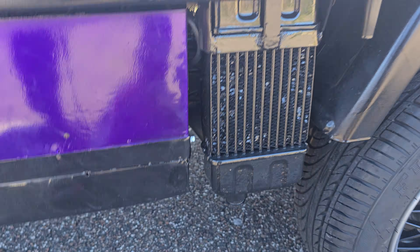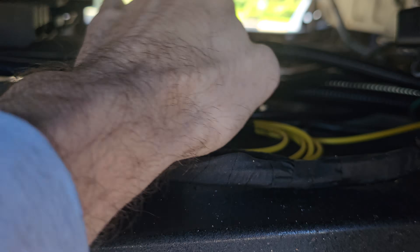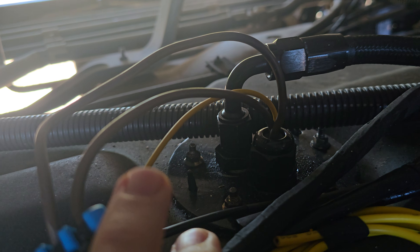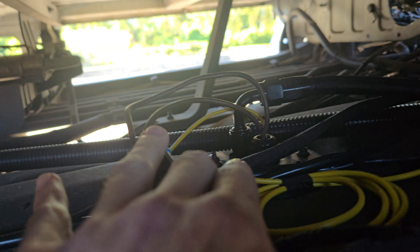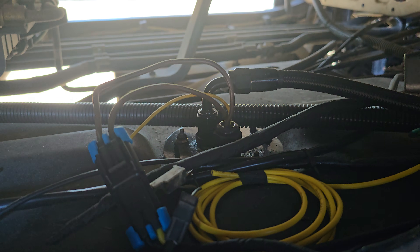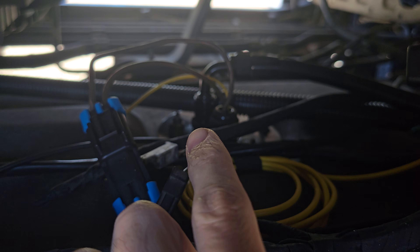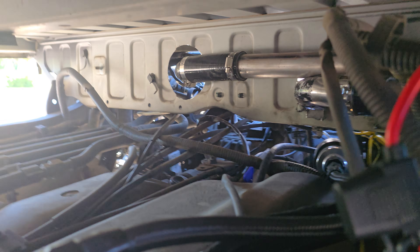Here's where we put the intercooler and battery. For the fuel pump — there was never an in-tank fuel pump, so we made a plate and attached a fuel pump into here, put a hose at the perfect distance. I still managed to wire in the fuel level sensor. The wires come out for the level sensor, the fuel pump, and the feed line — we welded that onto there. That goes into the top of the fuel pump, the feed comes down to a filter, and then to our fuel pressure regulator.